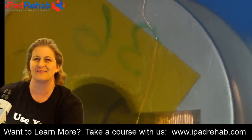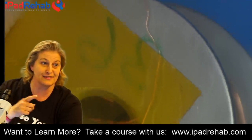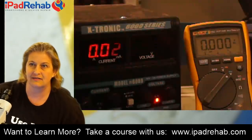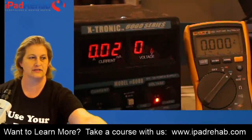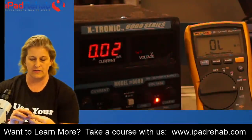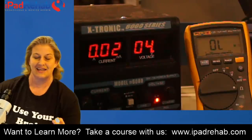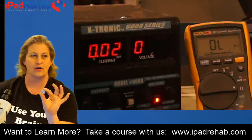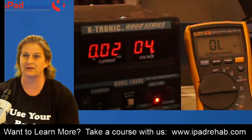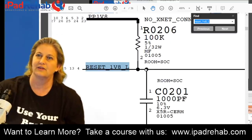Once you start looking for this reset line problem, you'll see it all the time. Looking back at all those other 20 milliamp phones - this was probably a really common mechanism all along. The jumper wire bobbin reads 98 ohms - so 'it's not 98 turns' - the answer is it has 98 ohms of resistance as measured with a multimeter. There is so much wire on the bobbin that it has just about 100 ohms of total resistance.